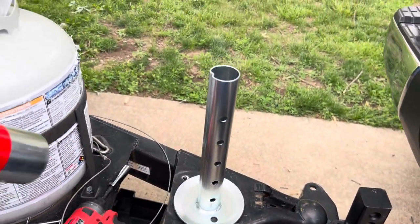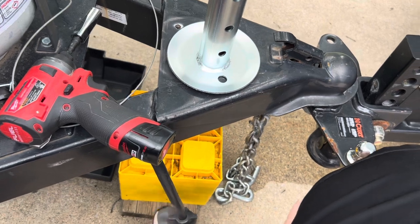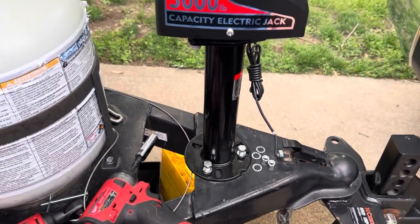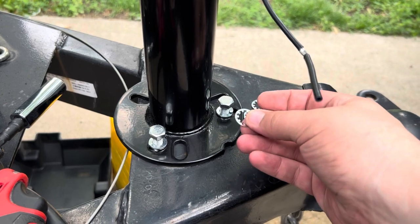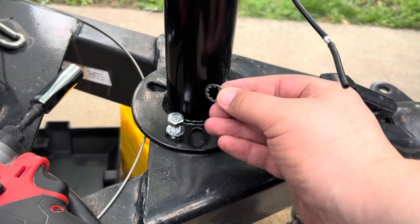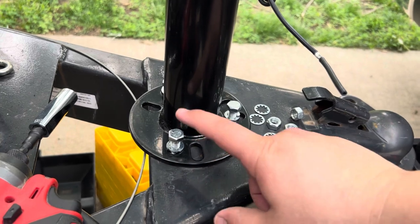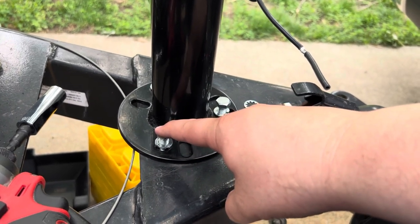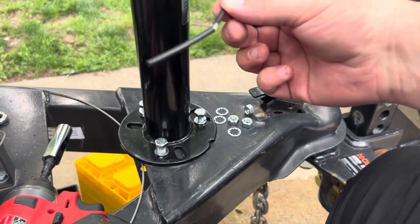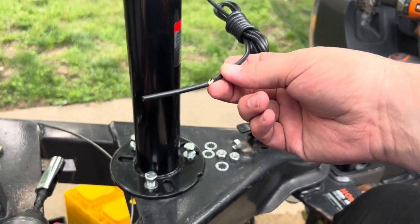Here's a picture of the foot plate when it's removed from the jack. We had to pull that out so the jack will go through the hole, and I had to kick my leveling box out of the way to put it in place. We got it on — bolts are started. It comes with star washers; the instructions say put the bolt through the lock washer through the mounting plate into the star washer, but these don't seem to secure on this particular setup, so I'm not putting them on. It did come with nuts, which the previous one didn't, and I might throw those on the bottom for extra security. We'll plug this into the battery — we'll need to wire on a ring terminal so it can go over the post, but other than that it should be pretty easy.